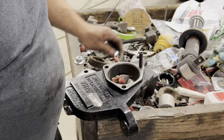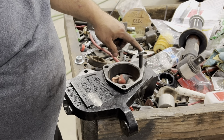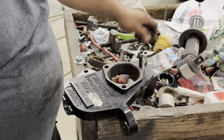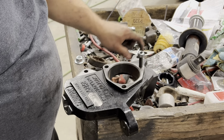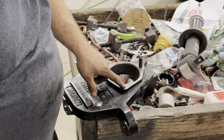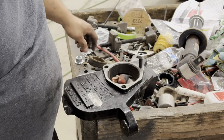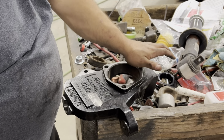Before you start these bolts, you need to reach between the hub and the stud and start this bolt. And then spin it down a little bit. You'll have to put a wrench in there to do it. Spin that down a little bit. And then once you get that started where it's pretty tight, you can tighten these two bolts and then come back and finish tightening this one. You have to have the rotor off the hub for that. So you got to do that.